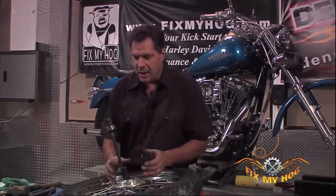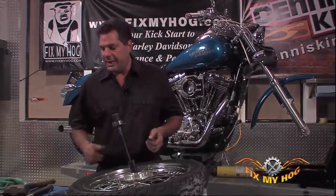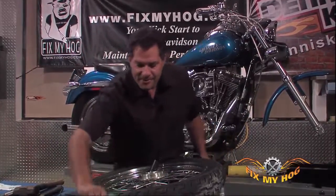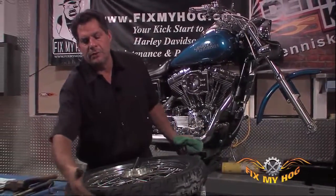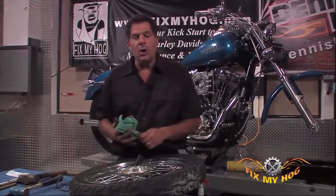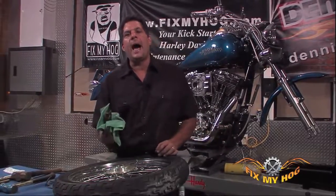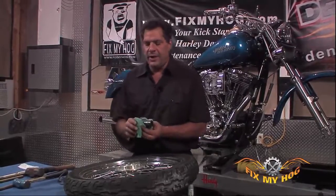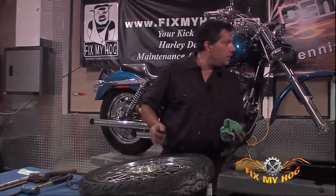So by heating it, we were able to release the rusted bond or the galvanic corrosion bond. The bearing was released. I won't grab it with my bare hands, although I have. I'll set it aside, let it cool. I'm really in no hurry to remove the tool from the bearing. You'll also have to use caution. The inner spacer will be hot. The inner spacer, even though it's not in theory directional, I would clearly mark it. Mark, can you hand me a permanent marker, please?